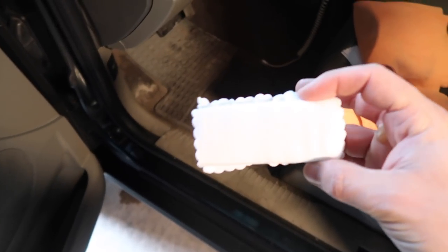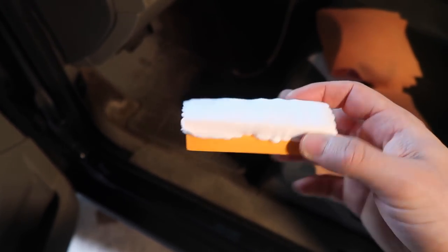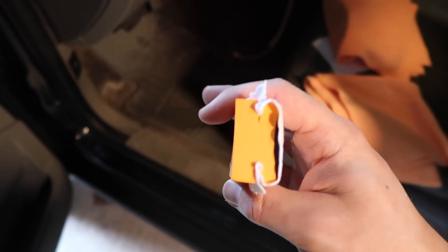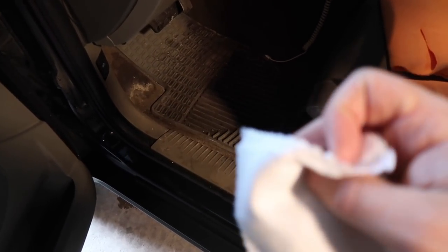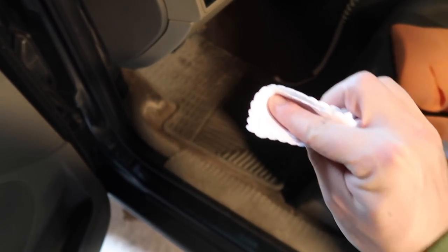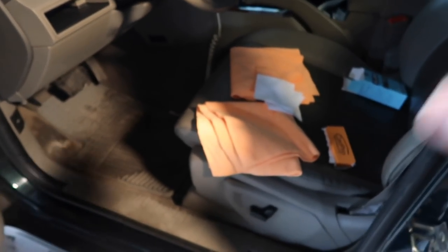And then they give you this applicator block and then the little pads, and a little trick which I didn't know for the longest time is to use like a credit card to press this in here, and then for the small areas use another separate one. I have a few here, but use one of these. You'll have a glove on to stick your finger and kind of go along the areas along a little edge that you normally wouldn't be able to get with this block, sort of around here. This can't bend, so you'll want to be using your finger for an area like that. So that's my little tip, and it should be pretty easy.